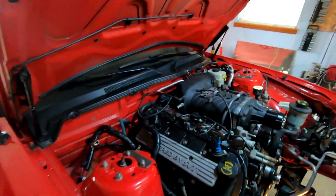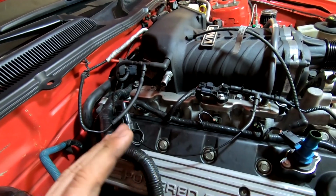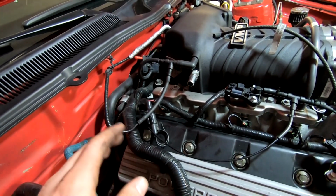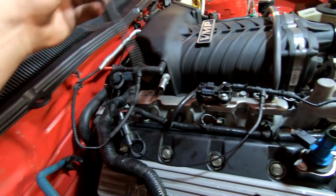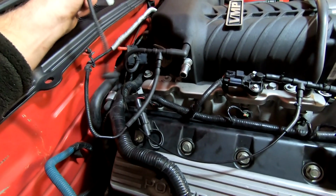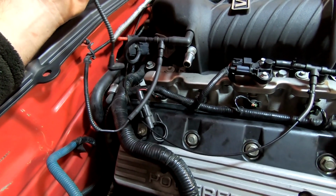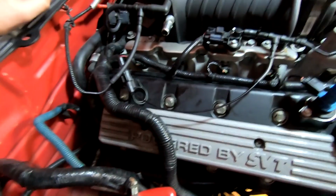All right, so after looking at this a little closer, basically what they're saying for the vacuum line, so everything's torqued down, by the way. I don't have an EGR on here, got deleted somewhere forever ago by the previous owner. So pretty much the way this thing was hooked up from the factory is this line ran from that supercharger area, the missing nipple, to somewhere on this side. I actually don't know where this other side came out at. But I gotta find that.